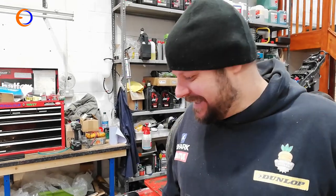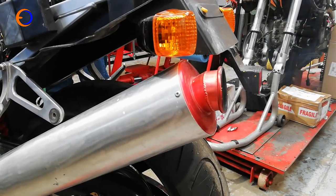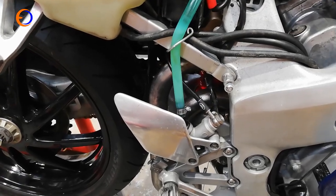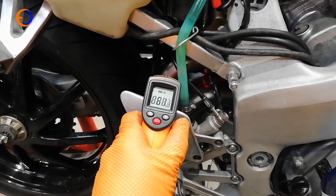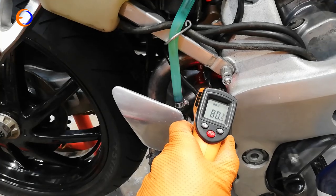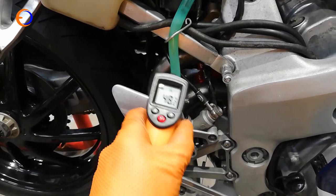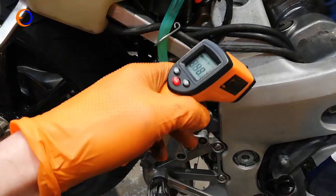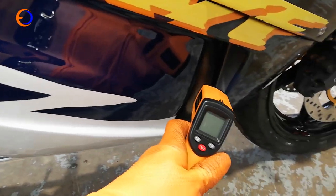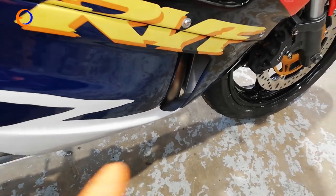A running bike would be cooler — it has been running quite a few times before but not on its own fuel tank. Then: it's alive — ish. Some life coming out of the end of that pipe. After running for a couple of minutes, a temperature test shows one pipe at 50°C, another at 80°C, one at around 200°C when running, another at 36°C, and a fourth at 126°C — though temperatures fluctuate because the pipes are bolted together in a manifold.